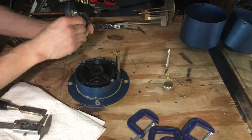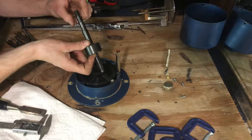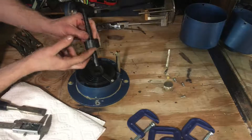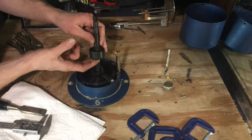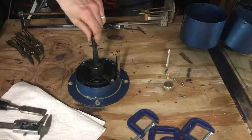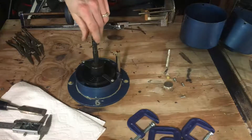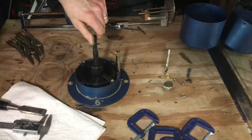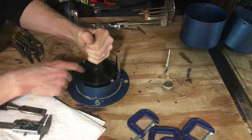These little inserts that you have for the bottom of this — go ahead and put those back in here, and also put your stopping pin back in here as well. You're gonna want to carefully lay it down while plugging up those holes so they don't fall out. When you spin it, you'll hear that clicking. Those things are falling every time it goes up the gear because it's a curved gear right here. And then when you turn it the opposite direction, that's when it catches and that's when you start to coil the spring.